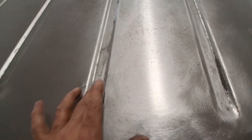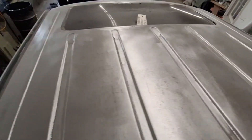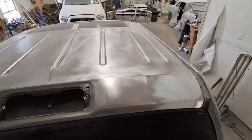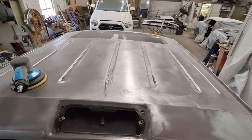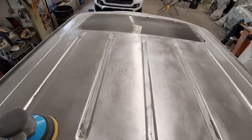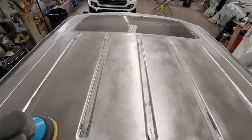We got the roof ready for epoxy. That is not rust — that is where the acid etch treated it, and it is supposed to not give any trouble. That is just dust right there. As you can see, it has been treated. We are going to epoxy it, seal it, let no moisture get to it, and then of course we will prime it and we will be good to go. This old roof is pretty rough, but the way we have done it I feel good with it — you acid treat it, then go back and sand it, and it should be good to go.